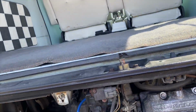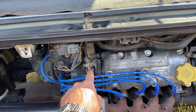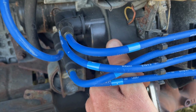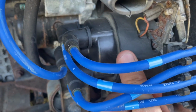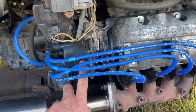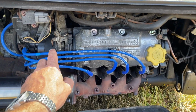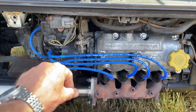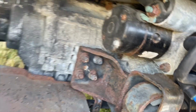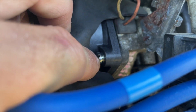I got it lifted up. And yeah, so she also had me do a basic tune-up, which was cap, rotor, and distributor cap seal, which is a big rubber O-ring. This one was kind of cool because this is very rare to see. There's actually a big rubber boot that goes over the cap and protects those screws, and I'm sure helps keep water from getting inside, but keeps those screws from rusting. I guarantee you, if that thing was not on there, those screws would have snapped inside that distributor like the last truck I was dealing with, because everything back here is so rusty. It would have been probably a nightmare. But since this little cap was on here, the screws came right out, no problem.